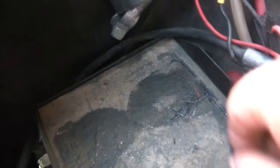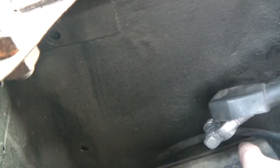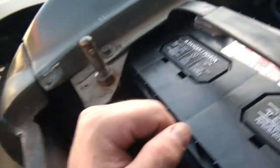Because it's going to be a super tight fit, I put it in to see if it clears. The negative terminal post down there isn't a big issue, but there's a lip here that — if I don't pound it down — is going to cut into the battery and eventually put a hole in it and leak acid. But even removing the rubber mat, I still can't get enough clearance under the terminal post.